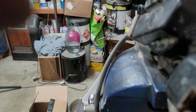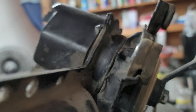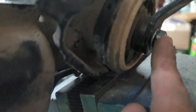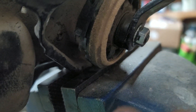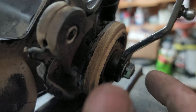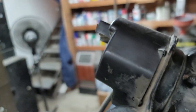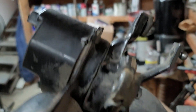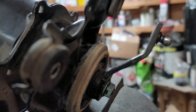I'm pretty sure what happened is they replaced this motor, took it out for some reason, put it back in, and when they were tightening this nut up right here, they really tightened it and made the motor spin counterclockwise a little bit. That threw the park switch and stuff off timing — that's why it's doing what it's doing.